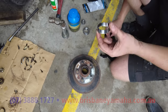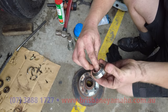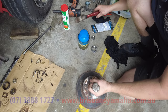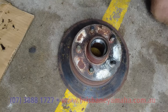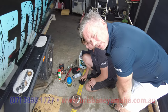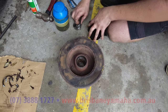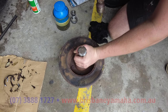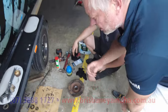You've got the small tapered end where your bearing will sit and roll — it will not go the other way. To get the race in there we've got a bearing race tool. You can hear that solid clank when it seats. If you're using the old bearing race to hit it in, just tap it in carefully and make sure you don't damage that edge. They're stainless steel and very hard-wearing. Flip it over and repeat the process with the larger one. You can hear it seat all the way in.